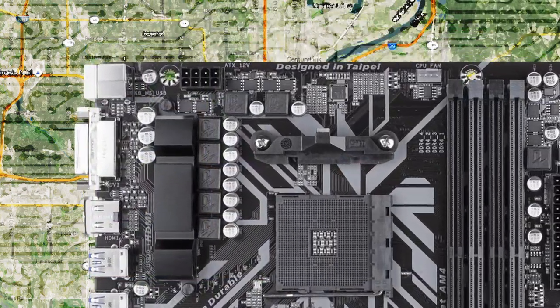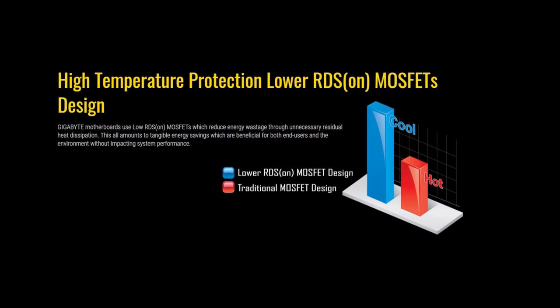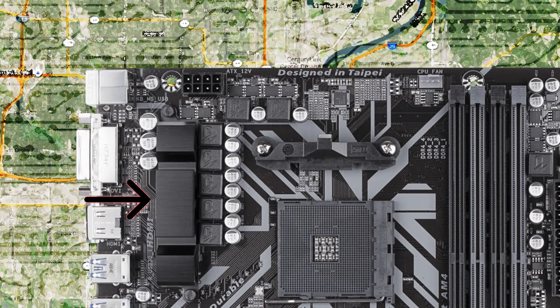Let's talk power delivery. It's a 4+3 phase design, and as with the Aorus M, Gigabyte calls it a hybrid digital power design — the main benefit being lower temperatures on the MOSFETs. Also like the Aorus M, there's only one heat sink and it's on the CPU section of the VRM. The SoC area is left exposed and will rely on passive cooling and case fans. This shouldn't be too much of an issue if you're using a discrete GPU, but there could be heat issues if you're using an APU such as a 3200G or 3400G. If you're using a stock Ryzen cooler or a third-party cooler that blows air down on the board, this should help keep those exposed MOSFET temperatures down.